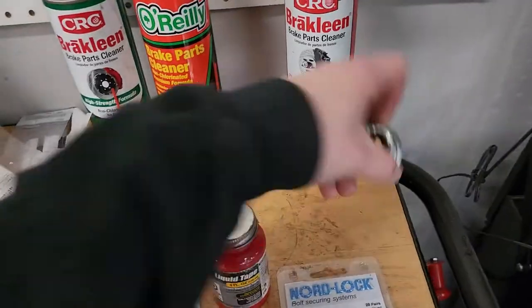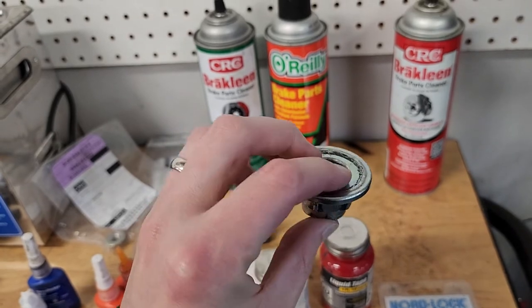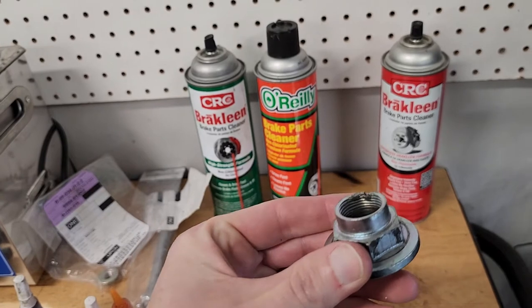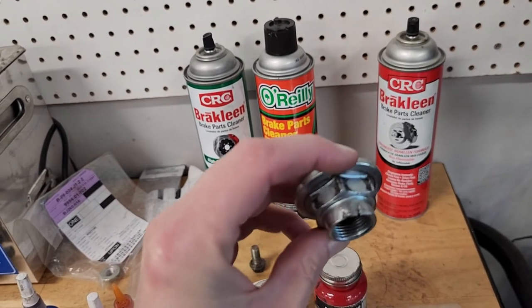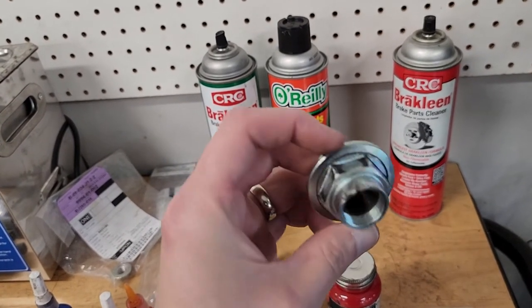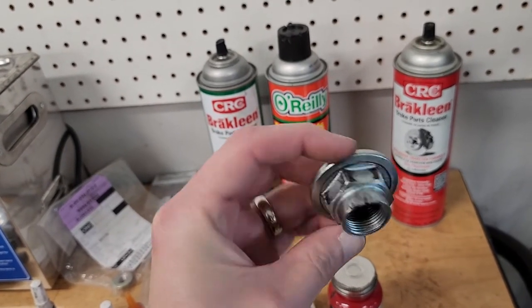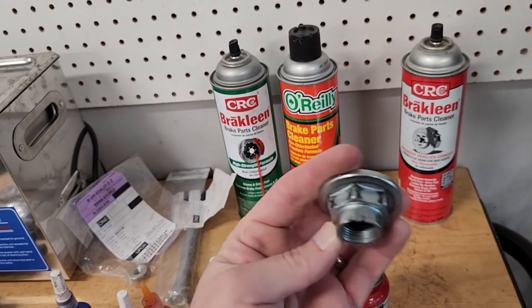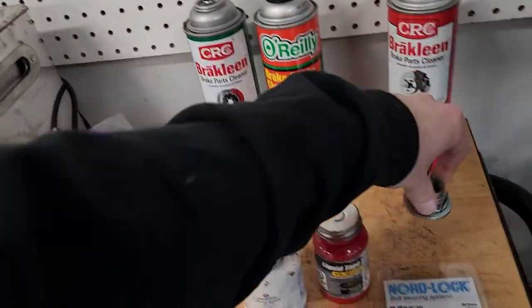We have our axle nuts, which we go through a few brand new ones every year. You can see this is not 30 years old. It's probably used for half a season. You can see in there that the threads start getting pretty marred up internally. You want to make sure to replace these if you can't index that down. It's really important that you have a good lock on the end of these because these will loosen. It could just ruin your stint, but it could also ruin your weekend. The whole wheel could come falling off if one of these things comes loose.